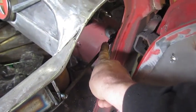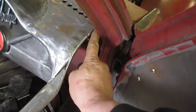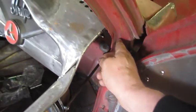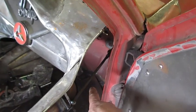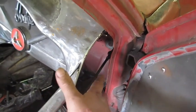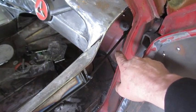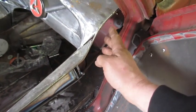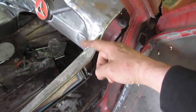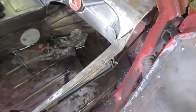I welded the lower dash mount support and there's a bolt in there — this will be the lower support. Now there's a rubber seal that has to go through here, so there needs to be enough room for that door stripping to get on this edge. Now that I got this thing solid, I've left it open so as the dash welded while warping, I can bend it back to where I want this long point to go on the door. Now that all the dash welding is done, I'm able to put the lower mount in. I'll get this hole out here on the door panel bolted up and I'll be able to cut this free, make the end cap of the dash, make the end cap of this piece, and then bring it out here and bolt it onto the door so it opens and shuts with the door on both sides.